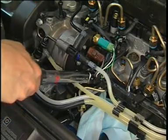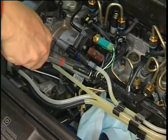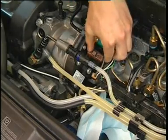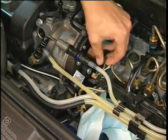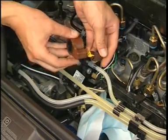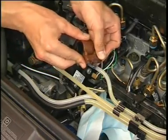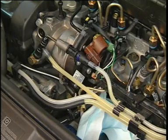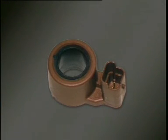In order to prolong their lives, high pressure pipes are only tightened to a maximum of 20 Nm. If work is being carried out on a Delphi system, the IMV — the high pressure pump filling actuator — must be disconnected. For applications with a controlled starting cycle, the ECU must be connected to the dummy IMV contained in the kit.